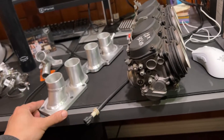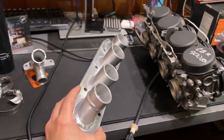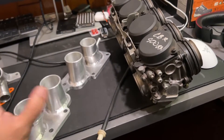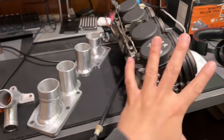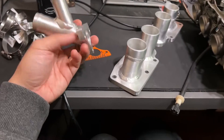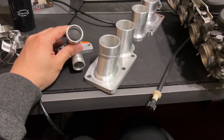What I did was go with a company — they don't get any promotion from me though, because I asked for a partial partnership deal since I'll be putting this on YouTube and eventually getting them sales, and they said no. But you can do your research and find a company that makes this manifold; it's not hard to do. You'll also need a water neck solution because the carbs are going to be in the way of that lower water neck in front of the head. Van Brenner sells one, and I think the ABA one works too.